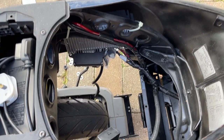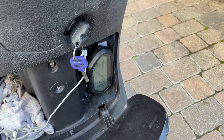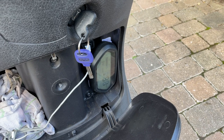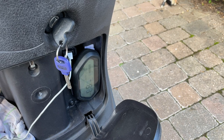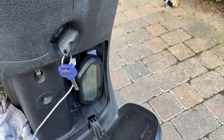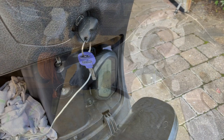So, bolt the motor back up and then I'm going to fire it up and see if it works. I got it plugged in now. Let's put this in first - you can hear it spin up and the speedometer says 51 kilometers an hour. Second, also 51. That's not terrible. And then - that high-pitched noise is something I've never heard. It's indicating 89. Let's see what that translates to into the real world when my weight is on it. But that is a massive improvement.